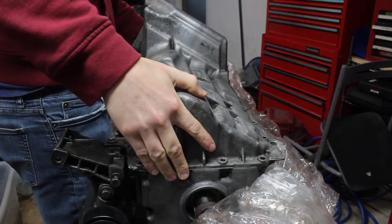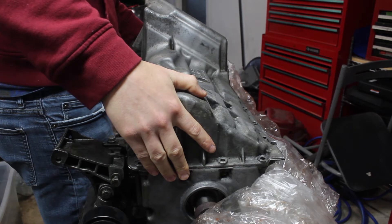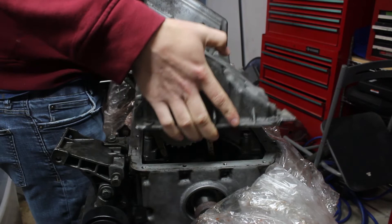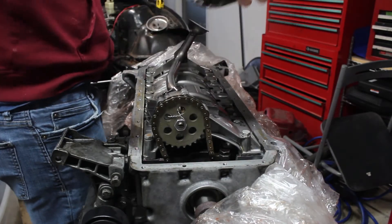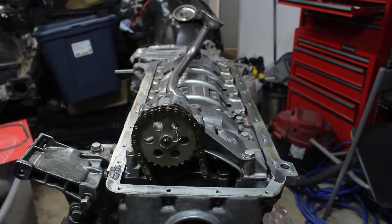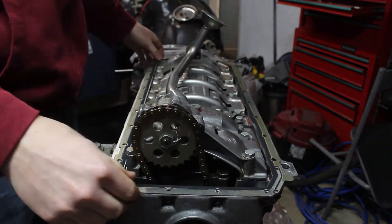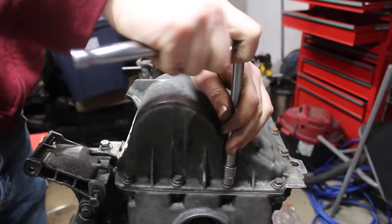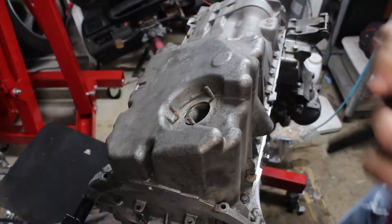With the nut finished up, I can install the oil pan. Unfortunately, the baffle wasn't welded in as low as possible in the pan, so it was hitting something. The support for the oil pickup needed some shaving. I was careful to wrap everything else in plastic to keep any debris from getting inside the engine. With the pan fitting better, I put some liquid gasket on the seam between the timing cover and block before installing the gasket. The numerous bolts got tightened up and I was sure not to forget the oil level sensor.